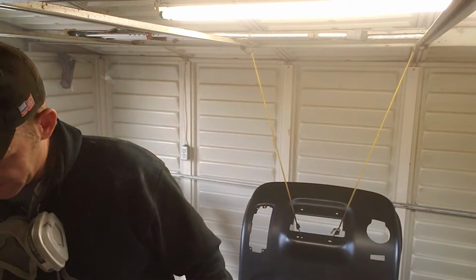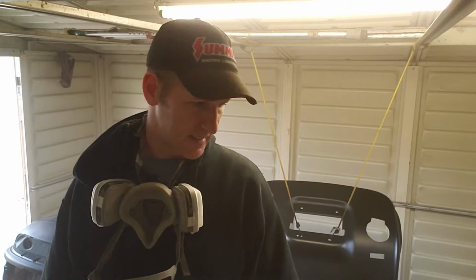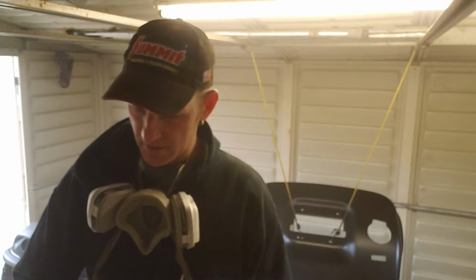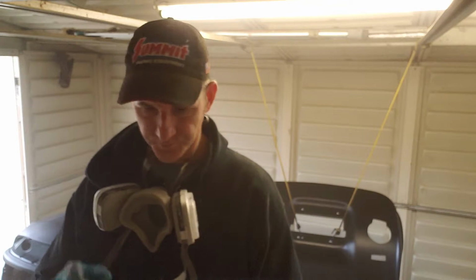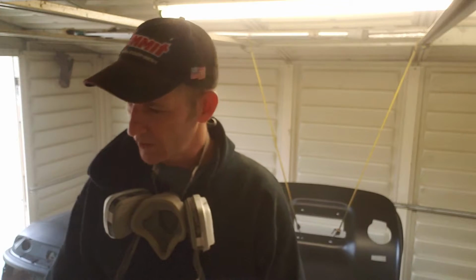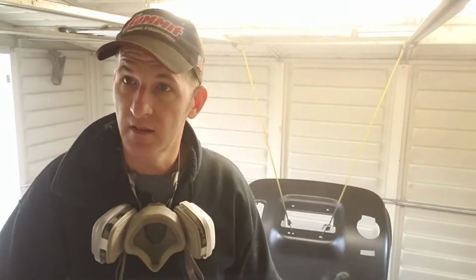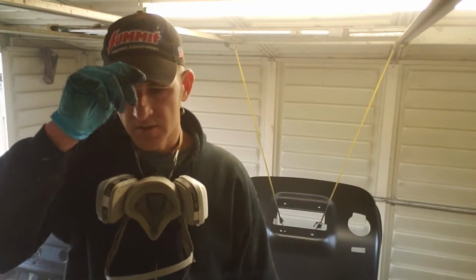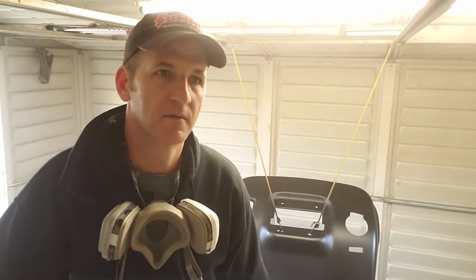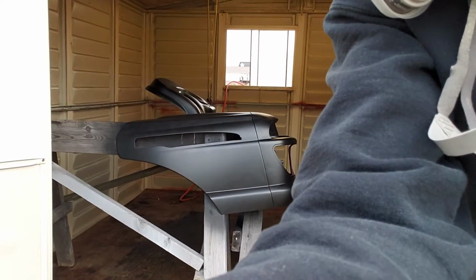We'll give this just a minute to tack up, and then we'll put our third coat on it, and take a last minute look. Sorry, I got hiccups again. If you know anything about me, you know I keep them. Take a last minute look at it before we do any clear. Now, when we go to clear, we're not looking for a deep shine. We're just wanting to lock this base coat in so that I don't have to go back and do any sanding or anything later on. So that's all we're looking to do. Alright, y'all hang tight, we'll be back.